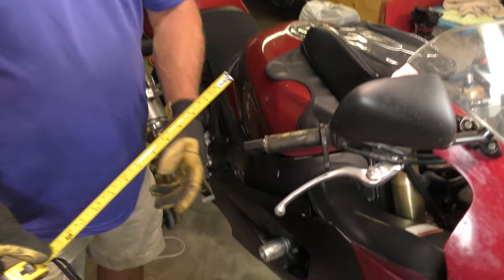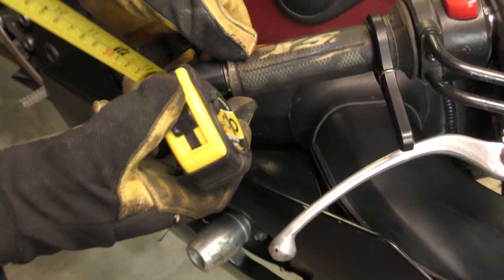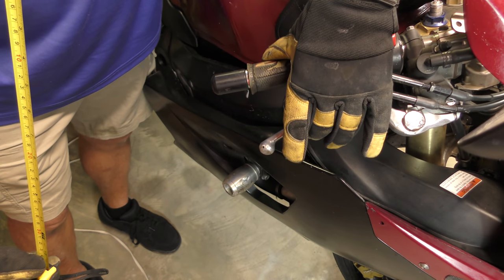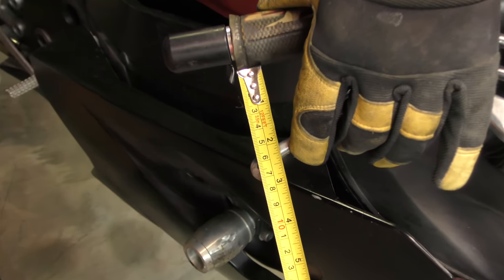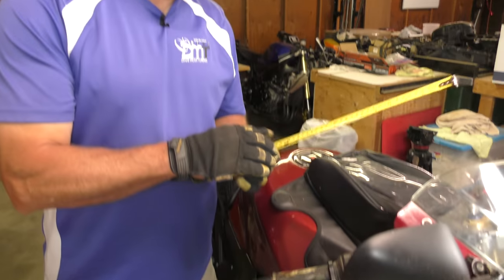The next data point is going to be pull on the brake lever from fully extended to all the way in, to see if there's a difference in actual depth of pull. What we've done is put a tiny black mark on the brake lever to measure. That's the raised lip of the grip — we're going to center the tape measure on that. There's the bite point. I want to find the bite point where I get pressure. Our distance for the Q3 is 62 millimeters.